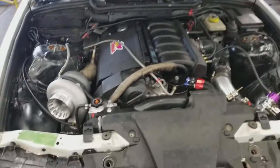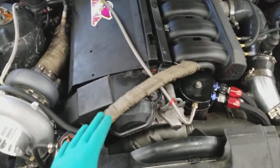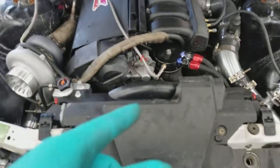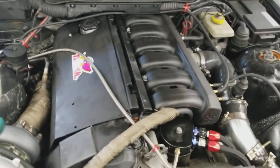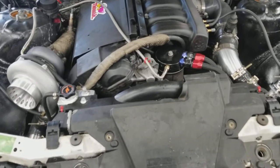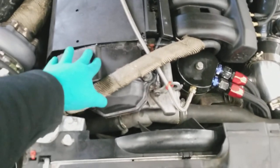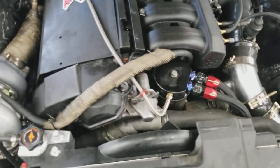While I was in there doing the head gasket job, I also replaced the timing chain, all the guides, and the crankshaft gear. I also welded the oil pump nut, which is very common on these cars — the oil pump nut comes off and you'll lose oil pressure, which is no good. The timing chain guides cost about $150 online, maybe less. The motor also has all new timing chain guides, Vanos seals and gaskets replaced, water pump, and thermostat — all that's been done.